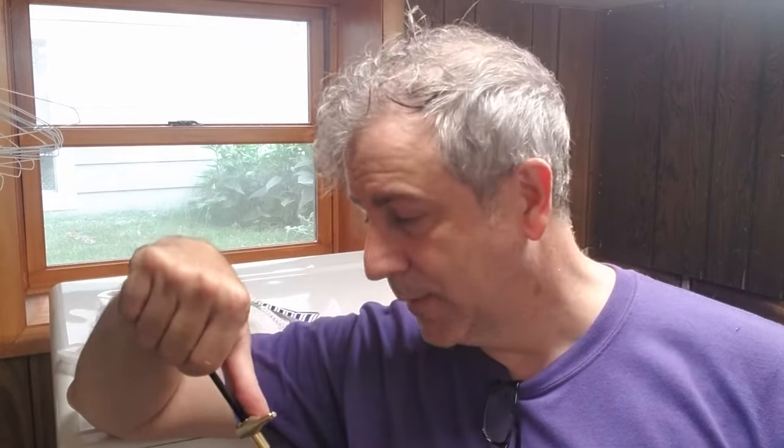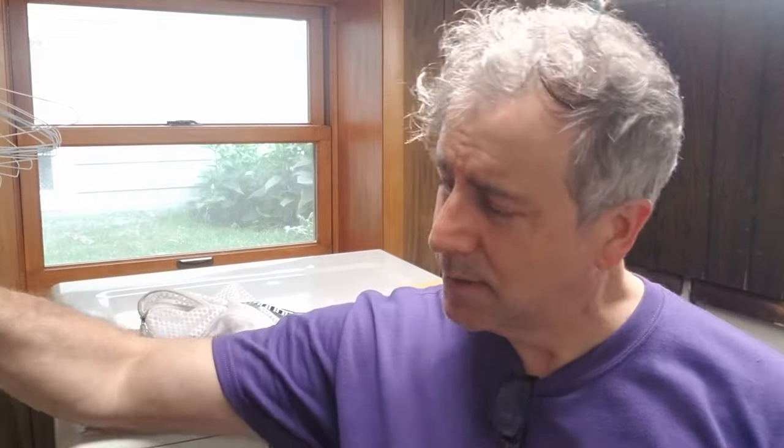Without it, I would say it's kind of annoying that you have to take off the front of this in order to replace the entire flange. Even more annoying is that you have to take off the front to get to the filter. Whirlpool, if you put a filter in, you might need to clean the filter every once in a while. And do you need to have a qualified technician come just to remove it and turn it and get rid of the gunk that's in the filter? Probably not. But hey, if you're going to check your filter, might as well replace the gasket at the same time. I highly recommend, if you're like me, 10 years in, you're seeing some issues, go ahead, buy the tools, buy the parts, give it a shot.